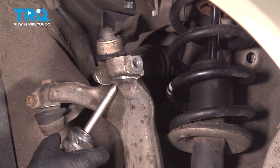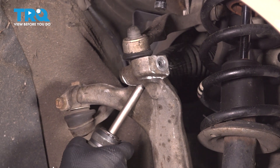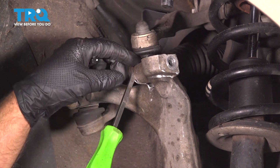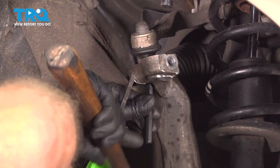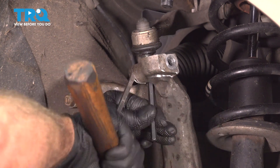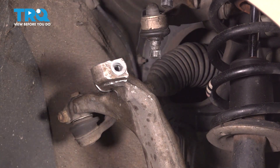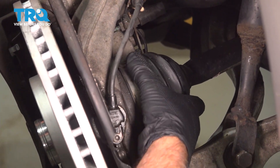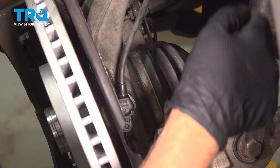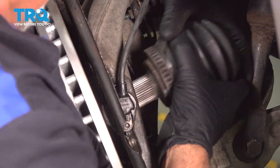You may need to use an air hammer. Just try to tap it up. Just using a little pry bar, split that a little bit and then just with a punch, try to tap this up. There we go, pop that out. Out of the way. I'm gonna take the axle out of the hub. Just pull this forward. You're gonna have to turn the steering wheel all the way to one side so that it's pushing the rack out — turn it to the left — and pop that out.